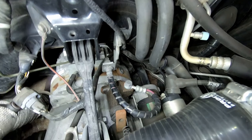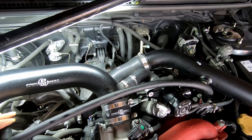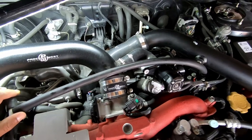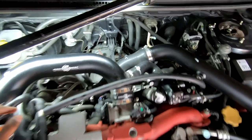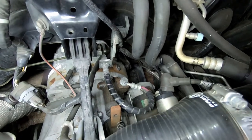So that's where the clutch slave cylinder is located. Now on this particular vehicle it's got a front mount intercooler fitted so I don't have to worry about removing the top mount. If you've still got the existing top mount you will have to go ahead and remove that first, and when you remove that then you'll have clear access to the clutch slave cylinder over there.